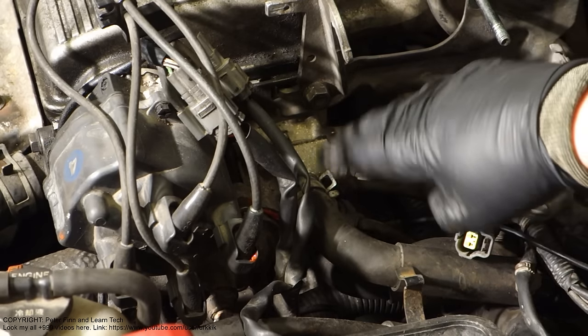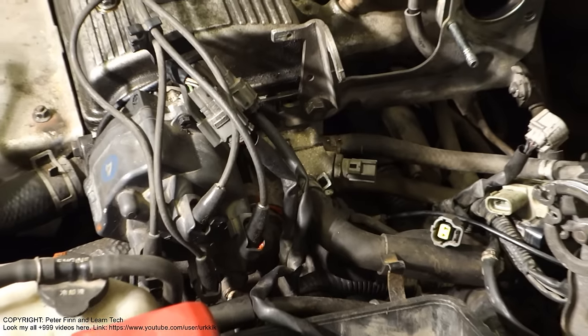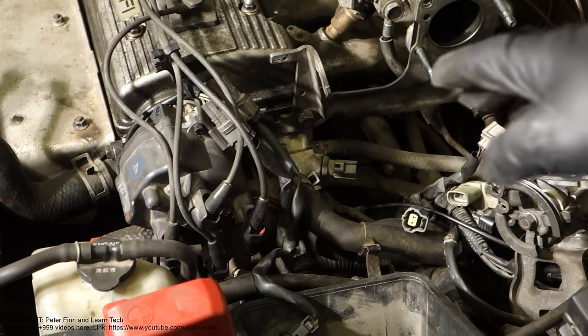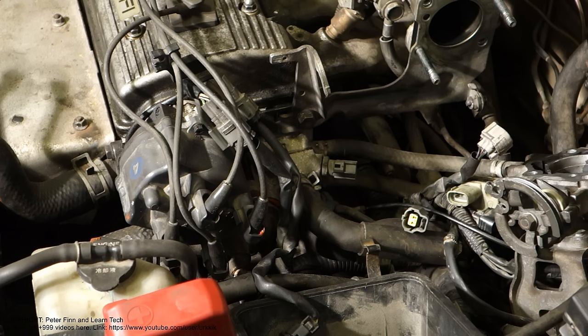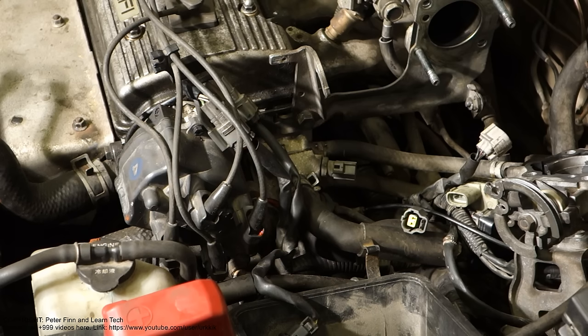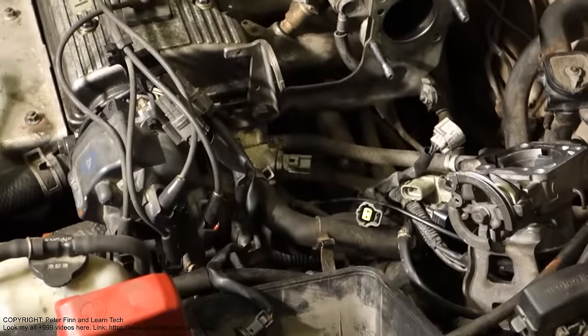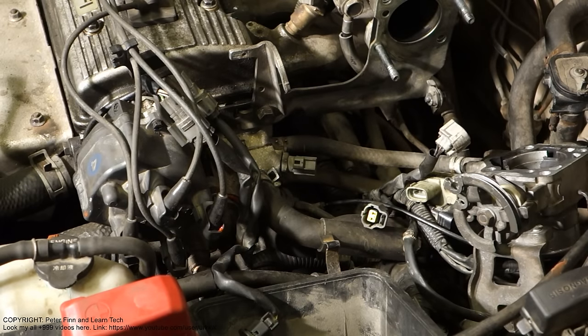And this measures coolant temperature, and normally this sensor sends data to the main engine computer. And when we would like to replace that, especially if we got trouble code 22, we need to do the next step. If you got trouble code 22 in a Toyota engine, it's good to replace this coolant temperature sensor, which is in here. Let's go to do that next.